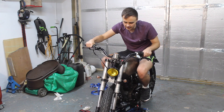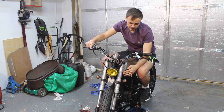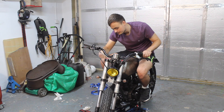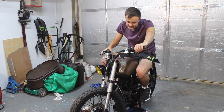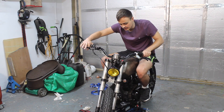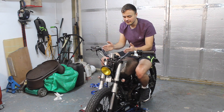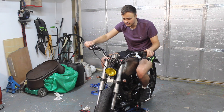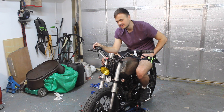The steering — he said he turned it from lock to lock and this fork here was touching the tank on this side. So I've adjusted the steering stop here to stop that hitting the tank, so it doesn't now. That hits the steering lock on one side, and that hits the stop on the other side, so it doesn't touch the tank. Basically, anything that interferes with the steering could count as an MOT failure.